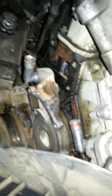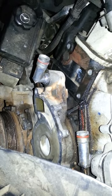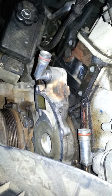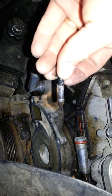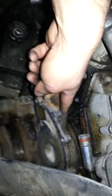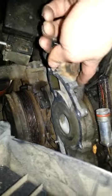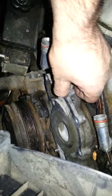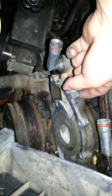I was trying to put a water pump in, but unfortunately one of the bolts broke — right there, about half of it. It's one of these bolts right here; the thread broke about right here. Had to remove the alternator. You can see the part of the water pump. So now I need to find a bolt extractor to be able to pull this out.